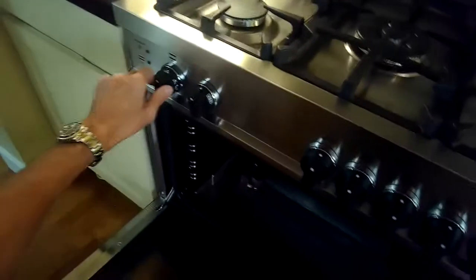So we have good ignition, just started it up. Flame looks good, nice and blue. A little bit of yellow tinge is okay. Just don't want a lot of yellow. So that seems to have helped. It gave us a nice fast ignition.